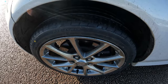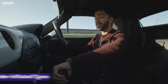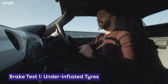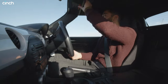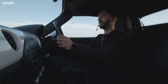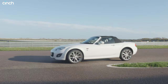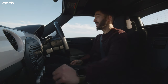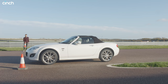Then we're going to rinse and repeat with the car with the correct tyre pressures. Let's get her up to 60 mph — which is countryside speed, not motorway speed. I couldn't quite hit 70 in our little MX-5, didn't quite have the grunt, so we're calling it 60. We're in third gear, 60 mph — clutch, brake. That was pretty impressive but the ABS was working overtime. I'm going to stop on this spot and drop two cones down to mark where it stopped, then we'll rinse and repeat.